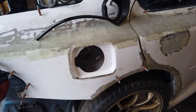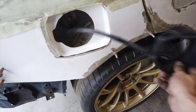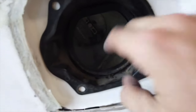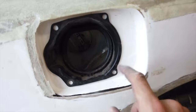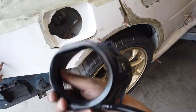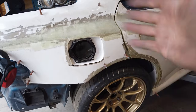The current state with the filler neck is as such — we have the new panel and the old bracket of the original car, which goes right in here. But now the bracket does not line up with the metal anymore and I can't even reach and open the cap. I need to bring the inside of the metal flush with the inside of this bracket so that it seals and everything is tight. The way to do that is first to attach this bracket to the quarter panels using four screws. Once that's done, I need to go in here and cut out the metal around the cap so I can move it closer to the bracket and make it touch the inside there.